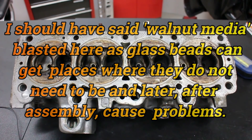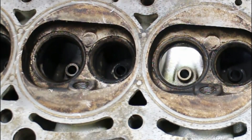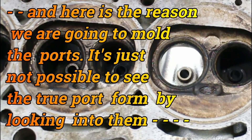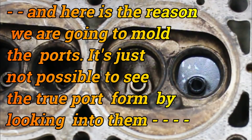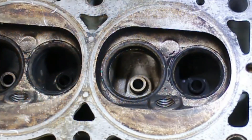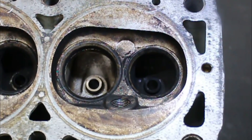Let's have a look at the ports and see what we're starting with. There's our intake port — it looks like it's got some potential. It doesn't look too bad in stock form except for detailing. Here's our exhaust port — difficult to see what's going on there because it's a bit black. As I've said before, the combustion chamber — a bathtub chamber — is not the best chamber to have, but we can do things with it. So let's start the ball rolling.